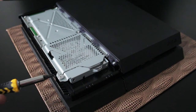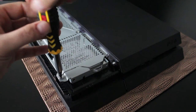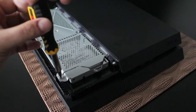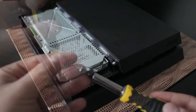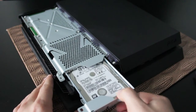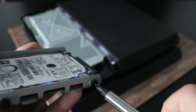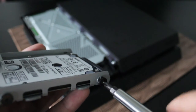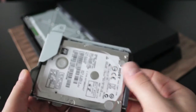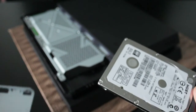Once you've opened the enclosure, locate and remove the screw right here. Something interesting is that it has the triangle, square, circle, and X imprints on the screw itself. Once you've removed that screw, pull out the hard drive — it should come out really easily. Then remove the four screws located on the outer edges of the casing. Once all screws are removed, pull the hard drive from the casing and set it down on a hard surface, not carpet, to avoid static.